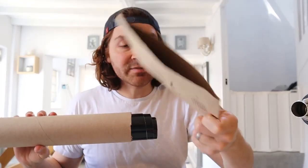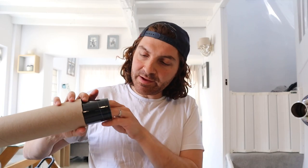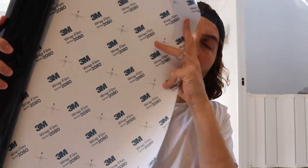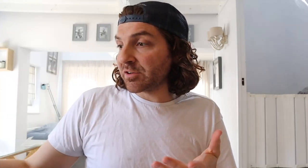I also wanted to do the rear tow eye cover. So let me show you what film I'm using — I'll put the Amazon tool kit link in the description below. I got about three meters of this black film. This is 3M and the type is 2080 wrap film. I chose it because it's good for wrapping vehicle parts, but mainly because it has a protective coat on the outside. So once you've wrapped, stretched and moulded it, you can peel off that clear layer and it leaves the gloss finish looking really good without causing any scratches or scuffs.